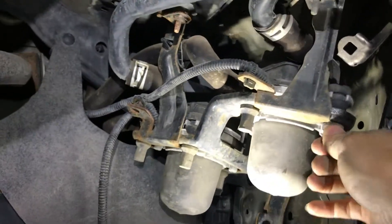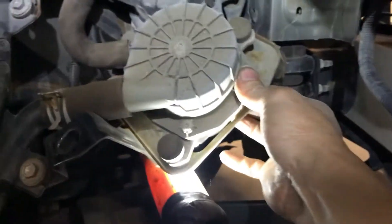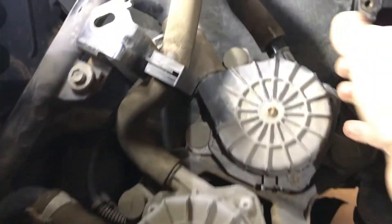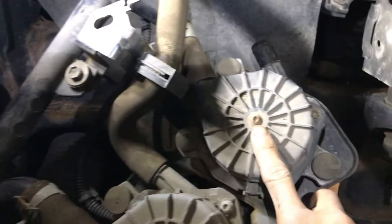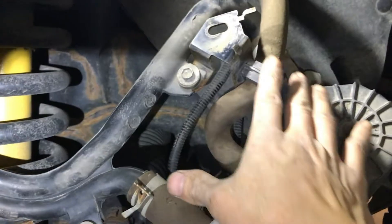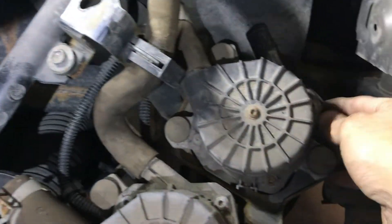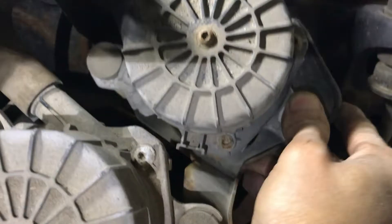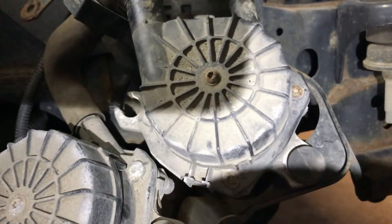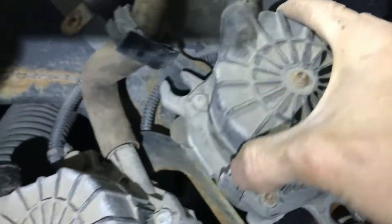After the two bolts and two nuts are out, the whole assembly should come down very easily. I didn't unplug the wiring for the bank two pump, so I just let it hang. Then use a flat screwdriver to pry out and disconnect the outlet pipe for the bank one pump — the one I need to remove. Both inlet pipes are held by two 10mm bolts, so remove that bolt and pull the inlet pipe assembly out. Use a flat screwdriver to pry the rubber clip out from the pump — it comes out very easily.